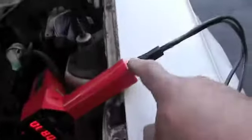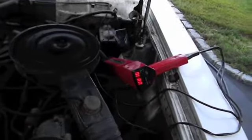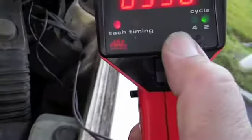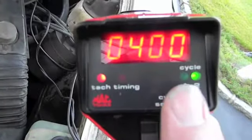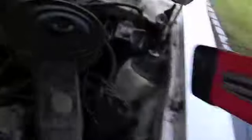Okay guys, I got the timing light working. I actually had a bad connection inside here — I gave it a quick reattach, I don't have my soldering iron right here so it'll have to do. That's what the car is idling at, out of gear. When you put this on, you can automatically see it's working — the dial reads up to ten degrees, back down to zero.